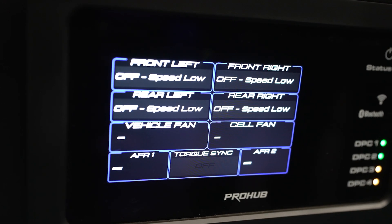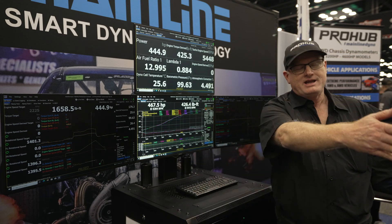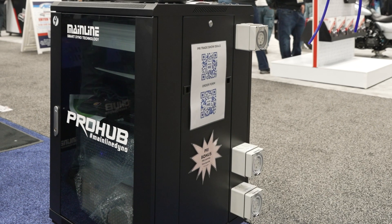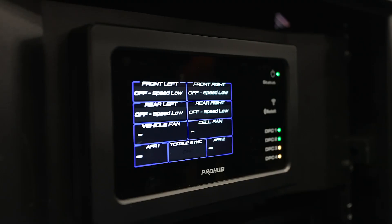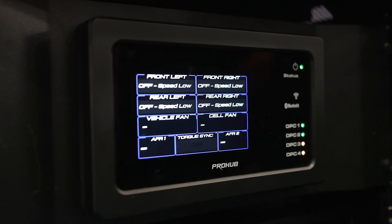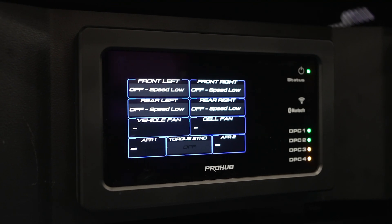The new system is like a very advanced dash. It communicates via CAN to two pod controllers in the case of a two-wheel drive hub dyno. The old system used a more rack-based, large PCB style arrangement, whereas this unit here is simply a very compact billet aluminium — looks fancy, very expensive controller, and very high speed.